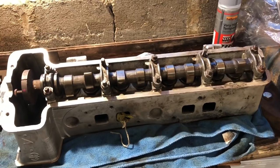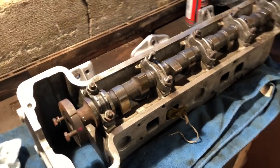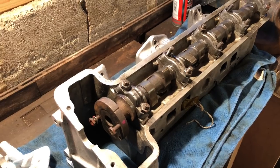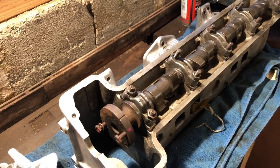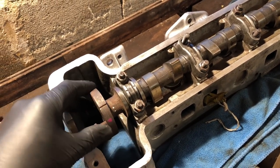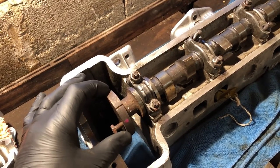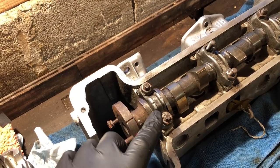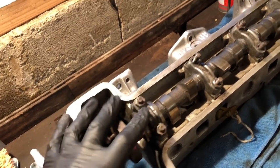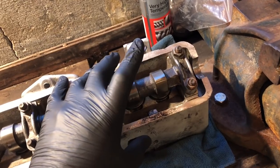So here they are in all their glory. I've had them skimmed and refitted so they're all ready to go. Just to talk you through the anatomy here — this is what has the cog on it off the engine. The timing chain sprocket is on the front, and we have to be aligned to top dead centre, which is just here. There are slots in the first journal and these two have to align to make sure the cams are all in the right place. All these different lobes are obviously for inlet and outlet valves on the engine itself.